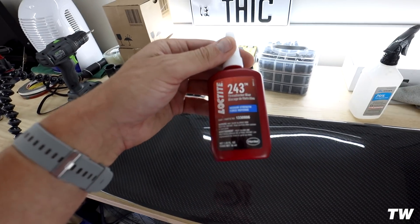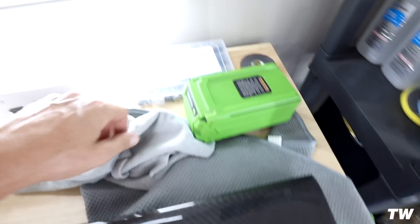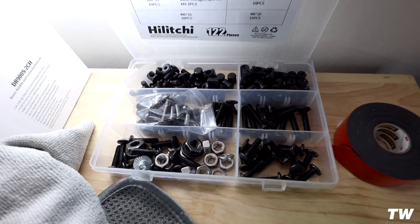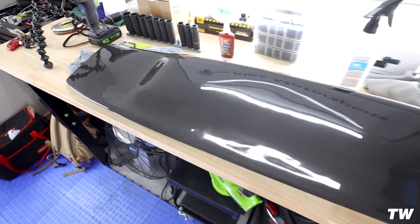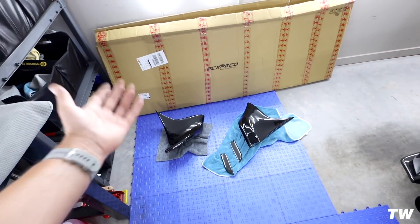The first thing we're going to do is line the lower part of these side braces with this adhesive foam that came with the wing. This is going to keep water from getting into our holes or hardware - we don't want any of that to rust. We were able to reduce the gap from before with a little bit of sanding. We couldn't go too aggressive because if you eat into that carbon fiber and clear coat you will crack it. For the bolts I'm going to use medium strength Loctite - not permanent, so I'm not worried about removal. I also got a full set of black M6 bolts which will look a lot cleaner.